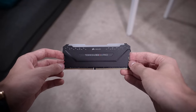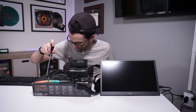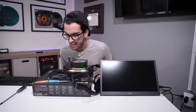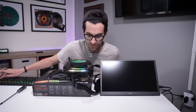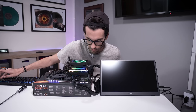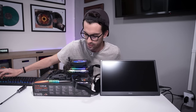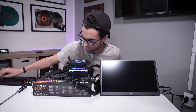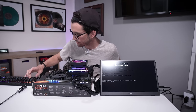But what exactly about the motherboard? We're going to try your theory from the comments — we're going to see if a BIOS update can fix this RAM compatibility issue. But first things first, we actually need to get the system to turn on. There's no BIOS flashback function on this board that I can see. So that means we actually need to get into the BIOS in order to flash a new BIOS. And it looks like having just a single memory module here is going to work — we're cycling through, there's the boot LED, so we should get a picture. There it is. So you just kind of have to keep plugging away at different slots. Trying to get into the BIOS — F1. There we go.